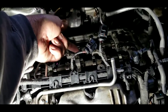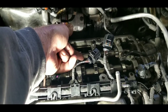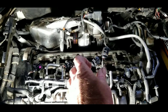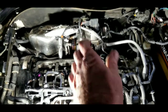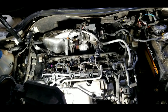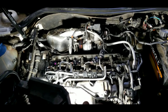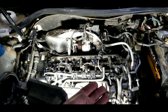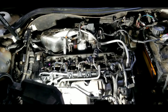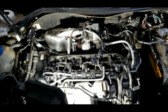To get the injectors out, I take a little pry bar and put it on the top of the stud and under the injector a little bit. What I do is wiggle the injector around a bunch of times, then pull up gently, push it down, up and down - and then all of a sudden it'll come loose. If they come out you don't need the slide hammer the factory says you need. Be very careful though - they're not cheap. Do that at your own risk.